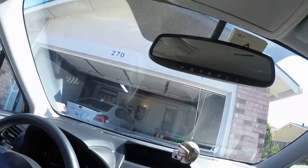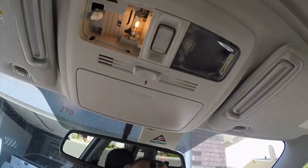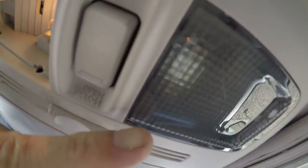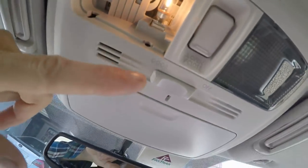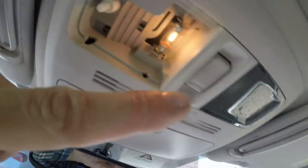So I close the door — it still stays on until you press the button. The dome light went out, but it's confusing everything. This one is flickering, and this one doesn't even go out either, and it's supposed to. So I think I want to put an OEM bulb on both sides and see if that solves it. That'll tell the final story.